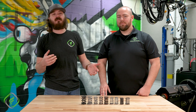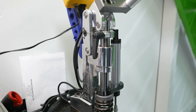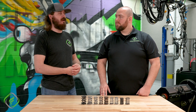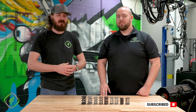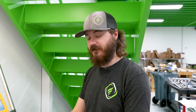Let's dive into some math and look at some numbers. We're going to use the Buxton setup and do some pull-downs to show the differences between valve springs — what install height means, what seat pressure means, what over-the-nose means, what coil bind is. We're back in our assembly area and I wanted to show a couple of different scenarios using our Buxton Engineering spring tester.